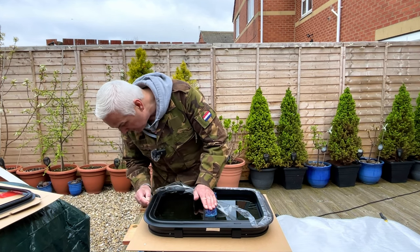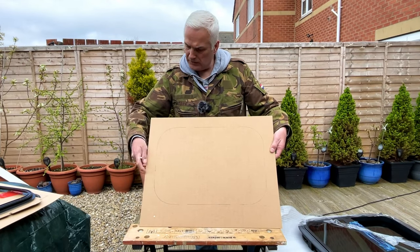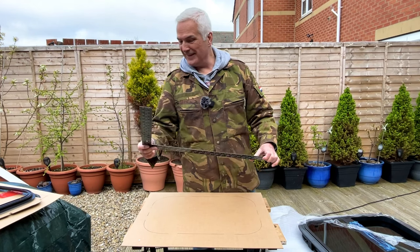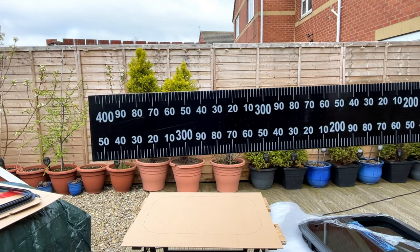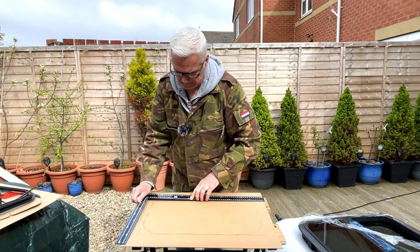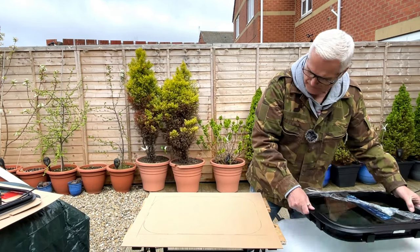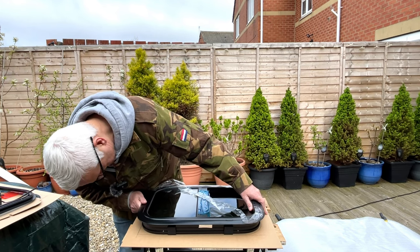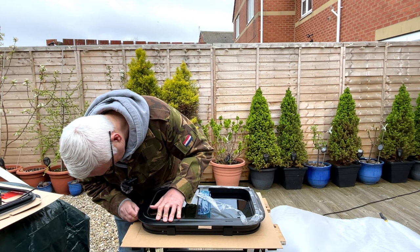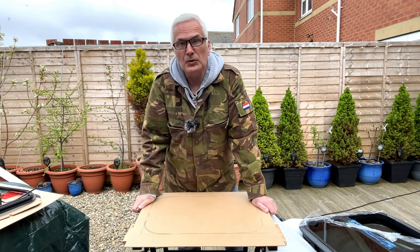Hopefully the curve will be the same. I'm just going to add on four millimeters on one side and three millimeters on the depth. I've got this new set square — I was doing some measurements the other day but those markings are two millimeters each, not one. Never seen that before in my life. For the corners we can use a compass or put the window back on and draw around it again. So there you've got it — three mil room there, four mil room there — and I'm going to cut that out with the jigsaw.